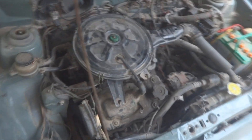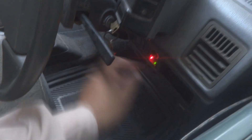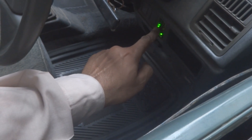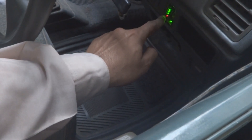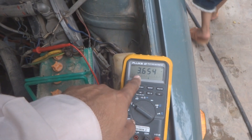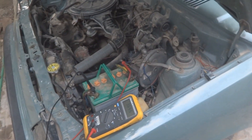I am starting the car now. You can see the kit — the red line is coming, and the other LEDs will also come. Once started, you can see two or three LEDs are on; the fourth one is not on, corresponding to the current gas quantity in the tank. On the meter you can see a pressure reading — a potential difference of about 3.6 to 3.7 volts. Now I will stop the gas from the tank.